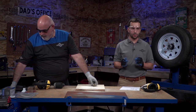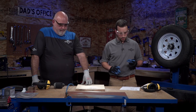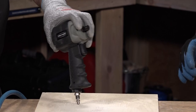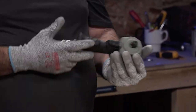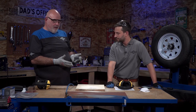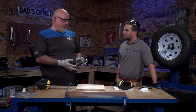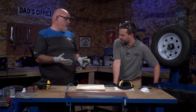For those just tuning in, you're watching See It Work. I'm Dan, this is Derek, and today we're talking about air tools. We've showcased the orbital sander and the flange punch, and now we're moving on to the one most synonymous with air tools — the impact wrench. This is a micro stubby impact wrench: small composite body, lightweight at around three pounds. It can be used for automotive repair — disassembling and assembling. Five CFM is the range you need to work this optimally, up to 15 CFM. It has a 500 foot-pound maximum working range. The Pro Point brand means it could easily be used in a trade setting, and it comes in at $149.99.